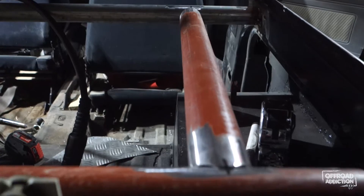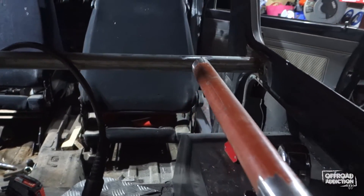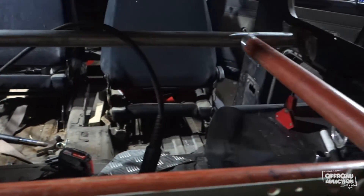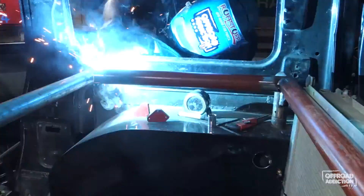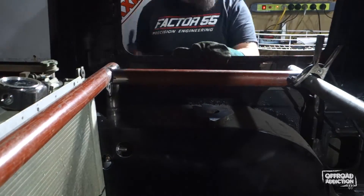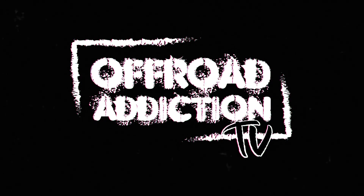What I've done now is added the braces in. I've tested the driver's side harness and it fits — all good. Now I'm just welding these braces in, in line with the guard, which is going to add a lot of strength. I've also got storage on top if I need it and access with the windows. Very happy — let's get it done.